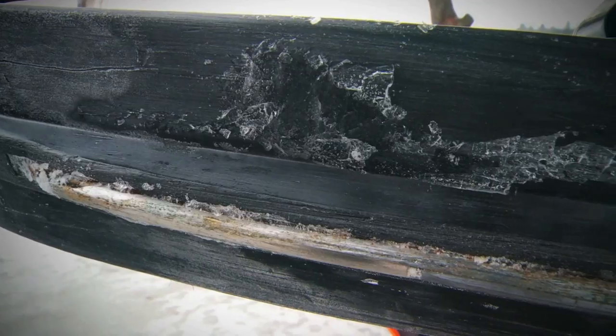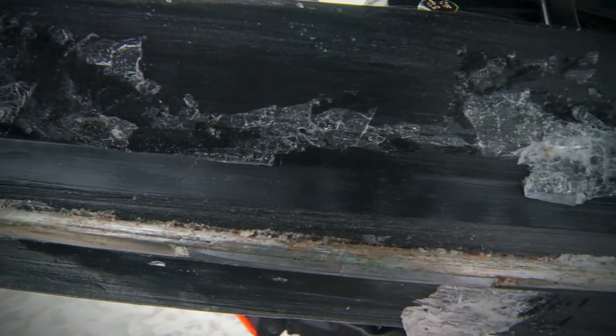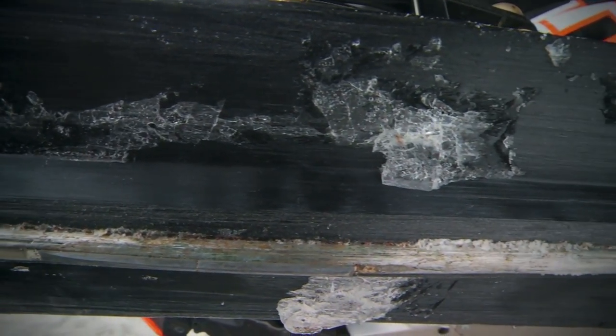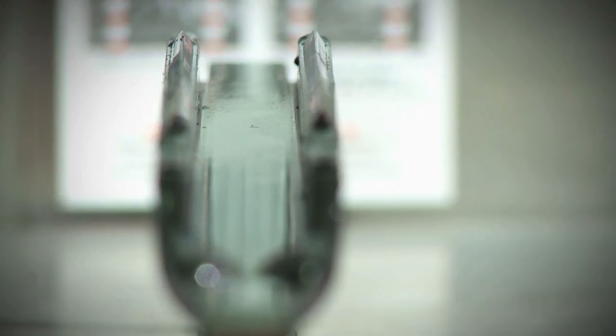When it comes to darting and drifting, reduced traction and control is often the result of a carbide runner that's either worn out or uses too little — or in some cases too much — carbide in the wrong places. While you may think single carbide runners are the only ones available, dual carbide runners incorporating two strips of carbide virtually eliminate darting and pushing issues across the board.